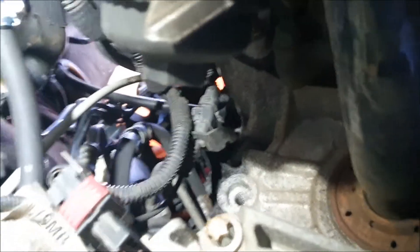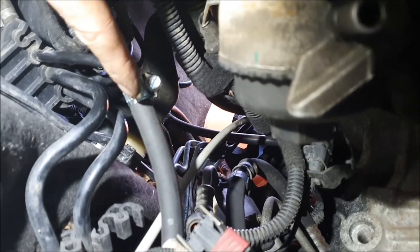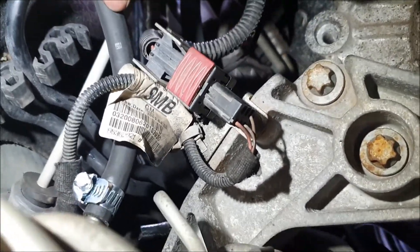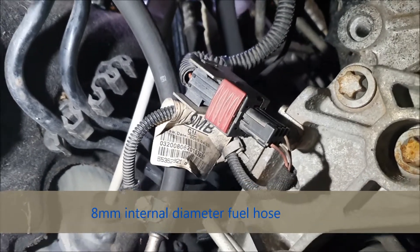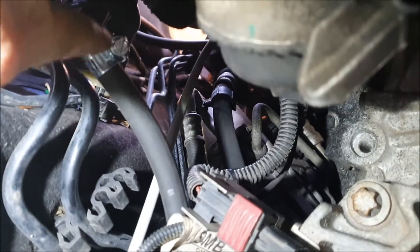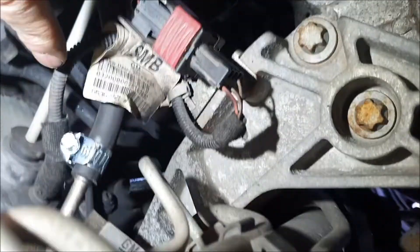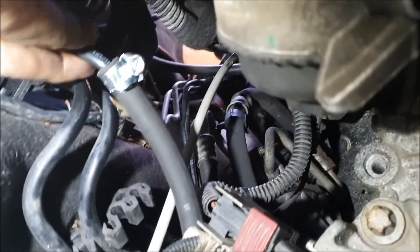There's my finger - there it is. Top hose clip onto the rigid plastic hose and a short length of rubber high-pressure fuel hose with a second jubilee clip on it. It's the smallest jubilee clip size in that set, which I think is something like 10 to 19mm. So that section is replaced - and I don't really see anything exhaust-hot to worry about, seeing as the exhaust is actually back over here. No doubt that pipe will generate temperature, which is what I think has made this plastic pipe too rigid.